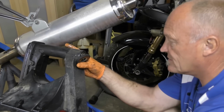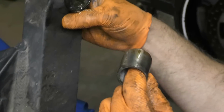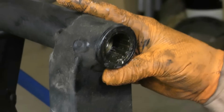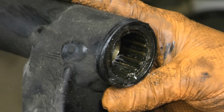Next on bearing checks. So this is a grease cover, which should have a lot of grease on it, which of course it does. Next comes the spacer, which is also the bearing surface, which... No, it's the inner race. It's not a spacer, you dickhead. Spacers space things out. It's to have a tolerance stack or just have a stack. It has grease on it. Yes. It's the inner race. And then, of course, we have yet another needle roller bearing set in each side. And then you probably want inside that on the bottom, back here.